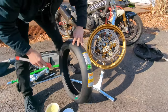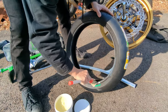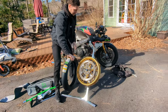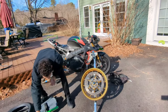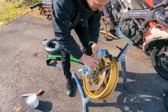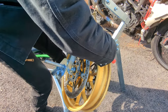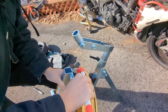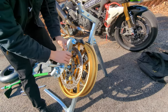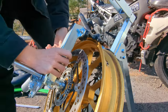My tire is prepped. Next step I'll set up the ratchet system. One tip I've learned: for installation, you can put some tire lube on the ratchet to allow it to slide on the rim a little better — put it on both sides to keep it from getting stuck. My tip here is instead of putting it right on the rim, I actually come off it just a few millimeters, and that helps me get a little bit of leverage and keeps it from sticking to the tire. I'm just going to tighten it up into place.